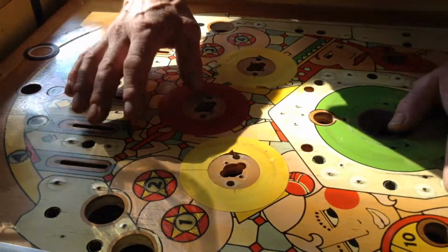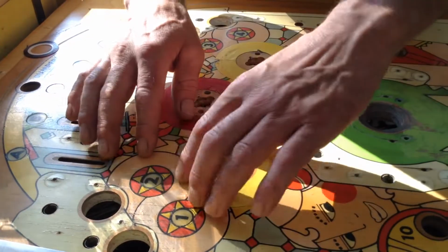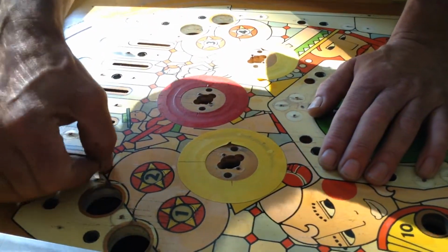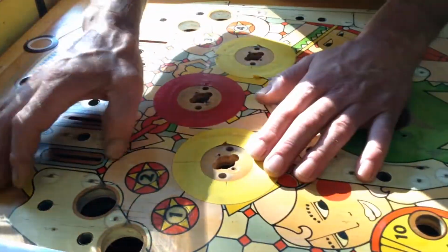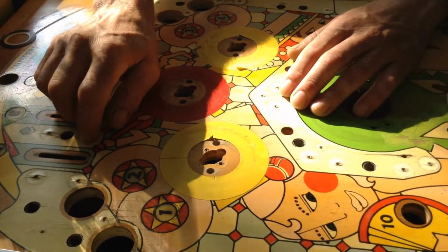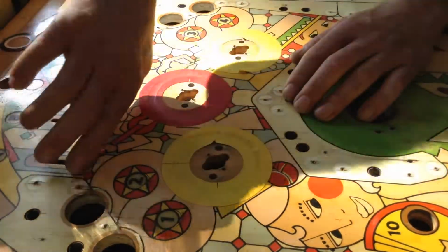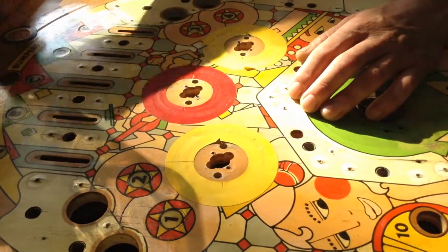Once everything around where you're working is dry, come back to it. Use your vinyl if you have to, make it up. And if you're a little crooked, you can correct that on top of your vinyl, make a new stencil. Set it down where you need it. Mark on the back side. Help draw on it with a marker. If you're out here on this black edge, we'll be able to come back, repair that, back mask that edge, use your stencil piece, put the black in.